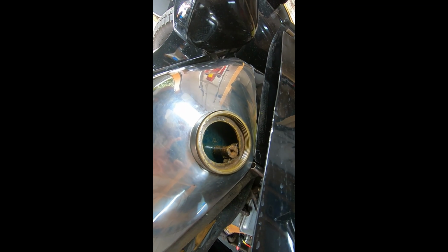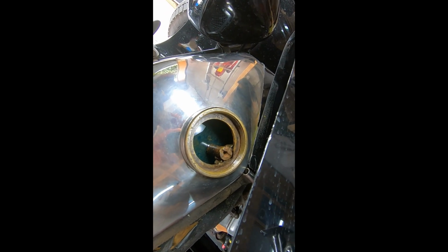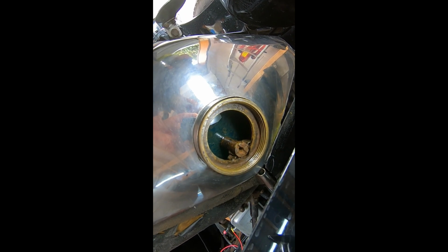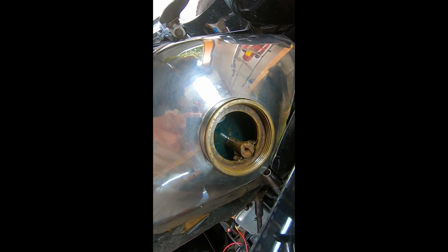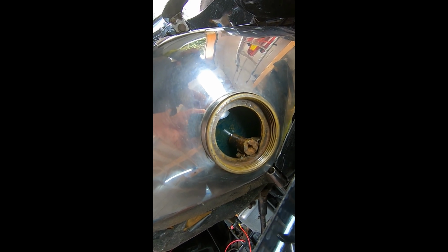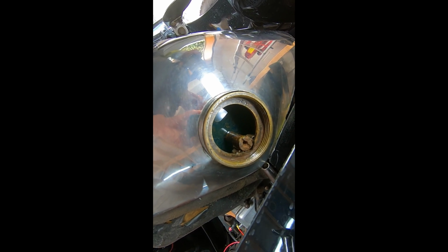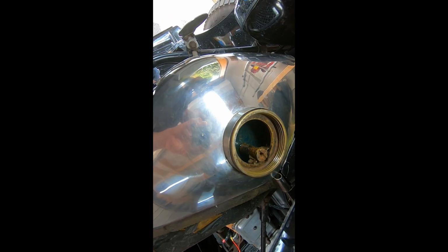Okay, the radiator is filled with water and Blue Col U. Just ordinary straightforward antifreeze. I guess you could use any kind of antifreeze as long as you drained it out properly. You don't mix antifreeze types, so the blue and the red or orange, you do not mix them up. So as long as they're all clear and completely washed out, you can put, I guess, whatever antifreeze in you want. I use Blue Col U, always have. And it lasts a couple of years, and change it every year or so.